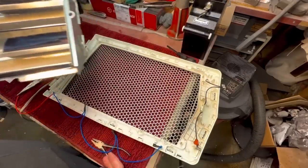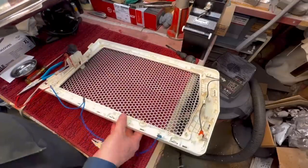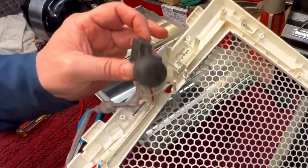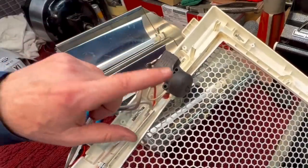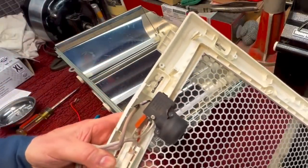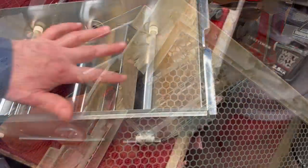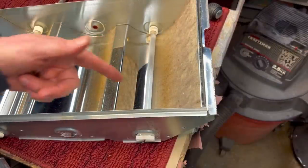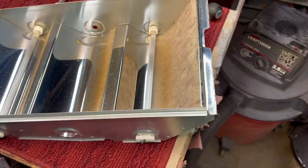So we're going to take this out because we want to clean behind it — that's the problem with this unit. We'll take the reflector out, clean it all up, and also straighten it out because it seems to have a little bend in it. Here is this tilt switch — if you listen, can you hear that? This will shut off the unit if it tilts in any position. So a lot of times, if you find a heater and it doesn't work, this is often the culprit — they stick. Now you have to be very careful with these bulbs because they are fragile, and you have to be careful not to get hand oil on them because that will shorten the life of it. So if you do touch the bulb, you have to wipe it down with alcohol to make sure there are no residual oils on there.